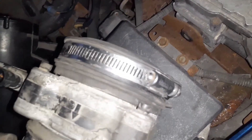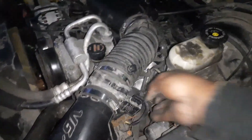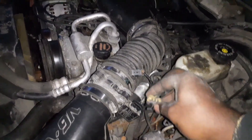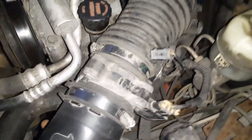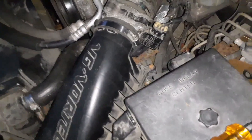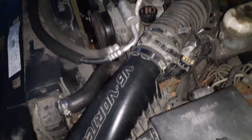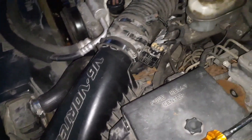Let me put this back together and turn it back on. There you go — all put back together. Just gotta plug these two plugs back in. Make sure you plug them in, otherwise it might run funny or throw an engine code. Everything put back together, clamps tightened up nice and tight — and you're done. That's how you clean the mass airflow sensor on the 4.3 Vortec 2001 Chevy Blazer. Don't forget to comment, subscribe, hit the like button, and turn on the notification bell for future videos.